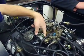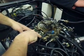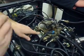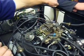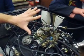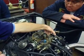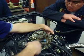It's on the lowest step. The car sits overnight. We have a device here called the thermostatic choke heater. The heater gets cold, cools off, and applies tension on this choke plate. There's a spring in here. Overnight it gets cold. When the customer gets in the car in the morning and hits the throttle, you'll notice the fast idle cam came to the highest step.